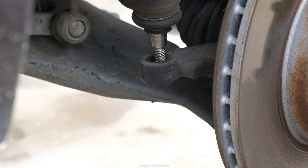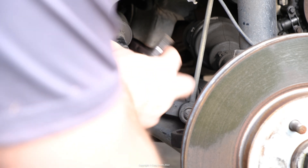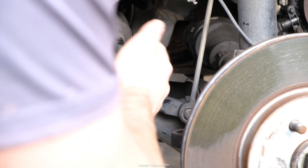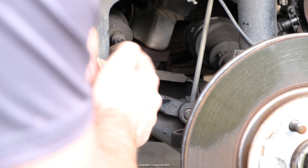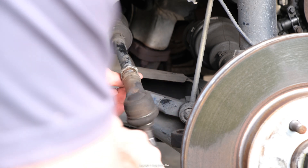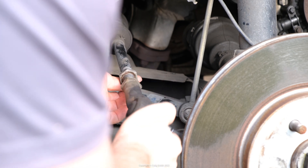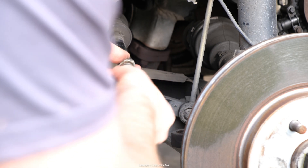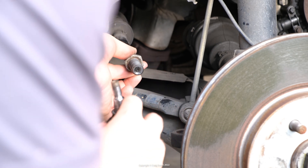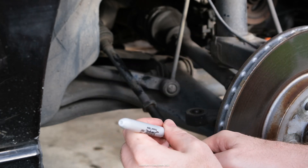Right away you might get an idea of the inner rod condition. If it's completely loose and floppy, as this one is, that's a clue the inner ball joint is worn. It should be a bit stiff ideally, or at least smooth and moving with a bit of resistance. In my case, this definitely wants replacing even though my main issue was with the rack. When you remove the outer rod, if you're replacing everything with the same hardware, count the turns taken to unthread it so you can put them back on as closely as possible.